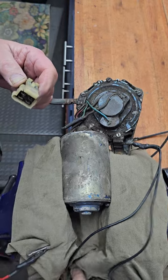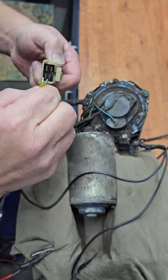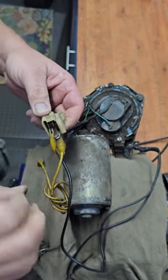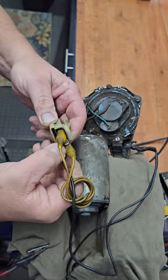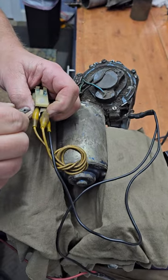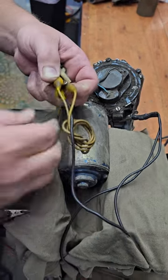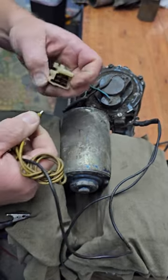In order to get low speed, you'll need a jumper wire from ground to green. Then take a jumper wire and go from red to brown — make sure none of that's touching. Then apply voltage to this assembly, between red and brown. That's low speed. Remove those wires when done.